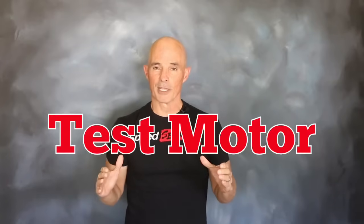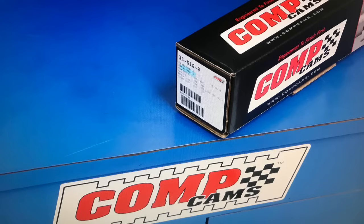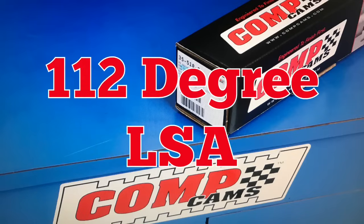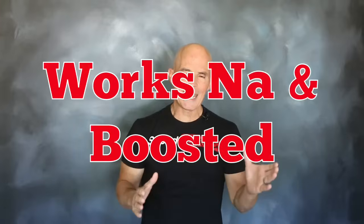Let's take a look at our test motor and check out the modifications we made before adding boost. Our test motor was a stock 5-liter Ford, originally equipped with iron heads. We upgraded those with a set of performance aluminum heads and a high-flow intake manifold. But the key to the success of our combination was the camshaft. We installed the Xtreme Energy 274 HR cam from Comp Cams — offering a 555-565 lift split, a 224-232 degree duration split, and a 112-degree lobe separation angle. It's one of my favorite cams for any 5-liter Ford application, offering a great combination of power and drivability, and it works well on both NA and boosted applications.